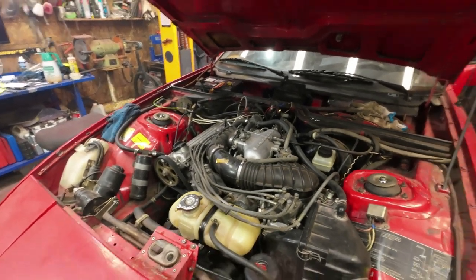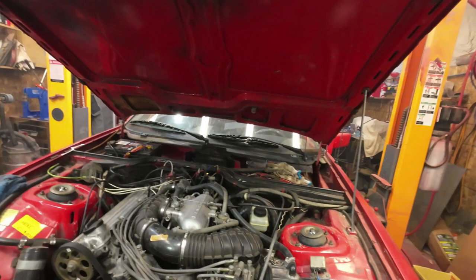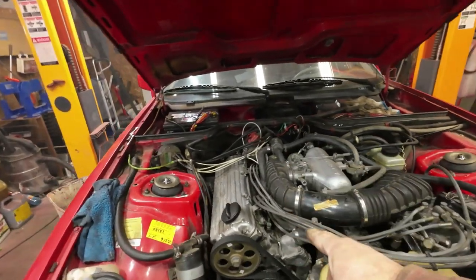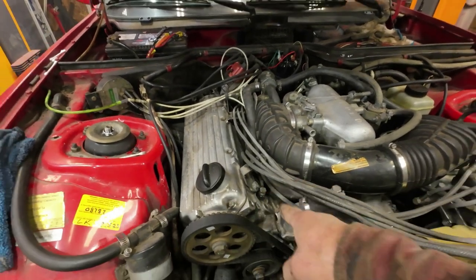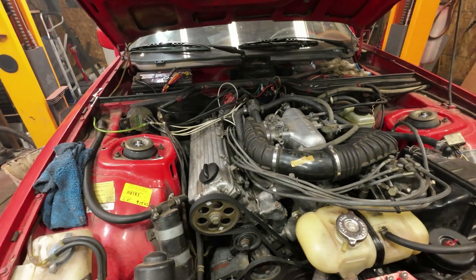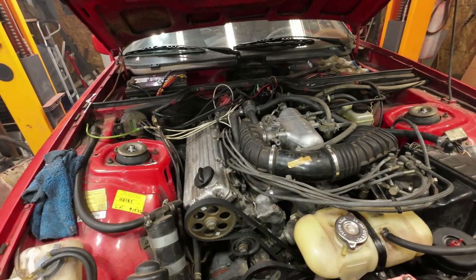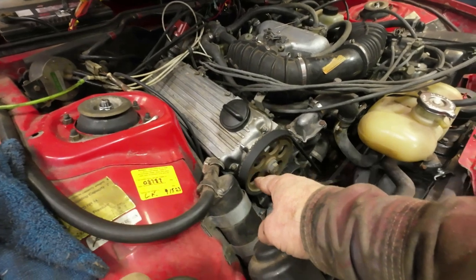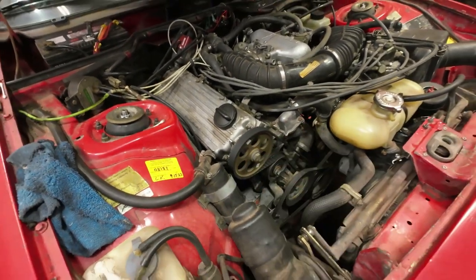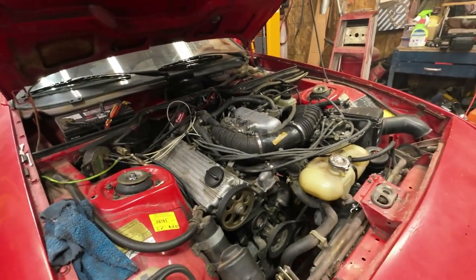And anyway, I think I've got the fuel pressure wrong. And then meantime, I'll also pull the injectors and check them to make sure the right amount of fuel is coming out. I'm also going to take the number one spark plug out of there and determine exactly where top dead center is, just so I know for sure where it is. Okay, that's for next week.